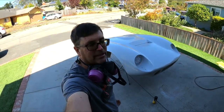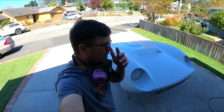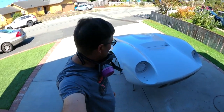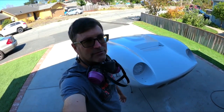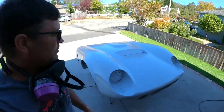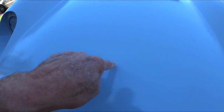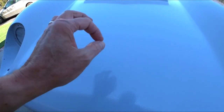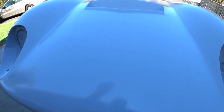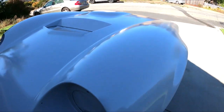Done. I had to clean my gun first because when you spray this stuff, it's basically liquid bondo — it's a urethane but it's almost like a body filler. You've got to clean your gun immediately; don't wait, get it cleaned, because if not you may never get it cleaned. Here it is — it's all primed. I had one little pinhole right here. For a pinhole, I grab a matchstick and dab a little bit of filler in there. That'll soak down the pinhole and when I block it out, it'll be gone. I don't have to chase those later on, and it looks pretty good.